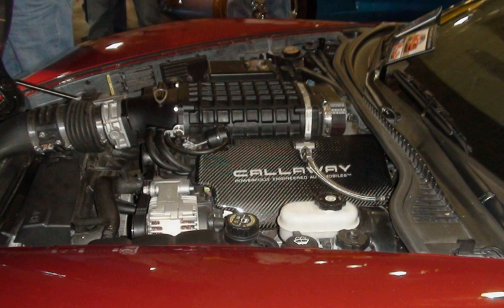The Gen V V6 engines are based on the V8 version of the Gen V family but with two fewer cylinders, a design lineage that dates back to the previous 4.3L V6, which was itself a Gen I small block with a pair of cylinders removed. Of special note, there were no V6 engines based on Gen II, III, or IV small block V8s. The LV3, dubbed Ecotec III 4.3L, is a Gen V small block V6 truck engine. It gets its displacement from a bore and stroke of 99.6 mm × 92 mm (3.921 in × 3.622 in) with a compression ratio of 11.0:1. Firing order is 1-6-5-4-3-2. This engine replaces the unrelated 4.3L V6 whose lineage dates back to 1978.